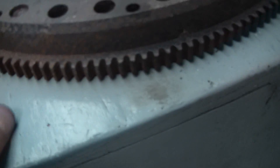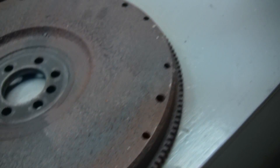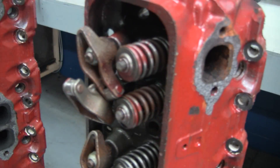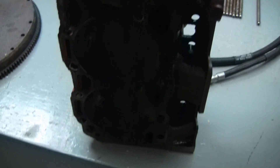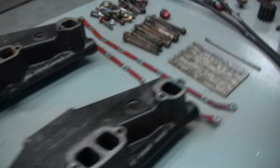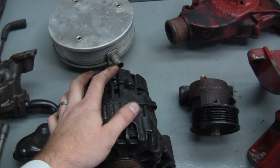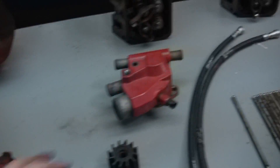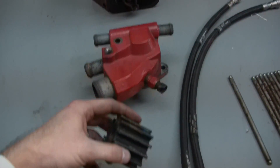We changed your flywheel — here's your old one. Ring gear teeth aren't bad, but it's one of those things where if you've got it out, just do it. There's your cylinder heads — all roller rockers, which is exactly what you got with the new engine. The alternator I told you I changed — it's starting to squeak a little bit. You don't want to put an old alternator on a brand new engine and have an issue down the road. Thermostat housing came off because the new fresh water cooling kit included a new thermostat housing, and I did change your sea water pump impeller too.